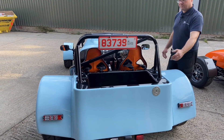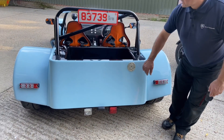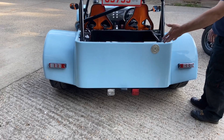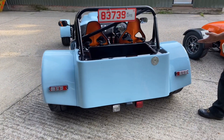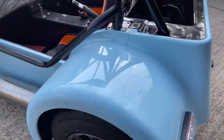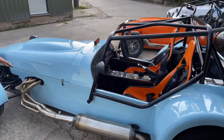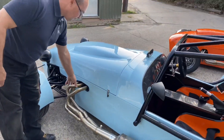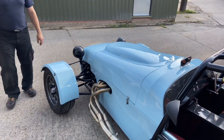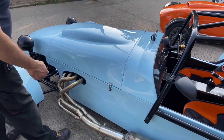It needs a light pack and an aero-style catch — a different kind of lightweight one that tucks up out of the way when it goes out on track. It's got Compomotive CXRs all the way around, our Triple 8 tires, and our manifold — the 4-into-1 we do for the CBR. It's got our cat silencer on at the moment for IVA. Neil's just noticed there are no bonnet catches, but we've trial-fitted a solution.